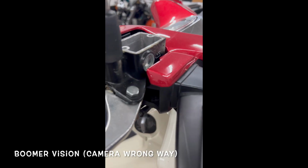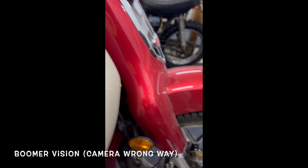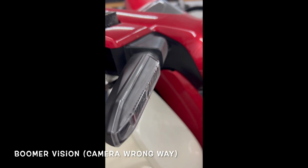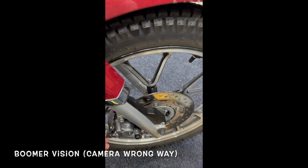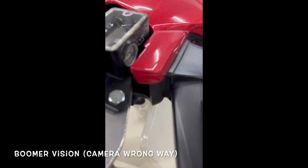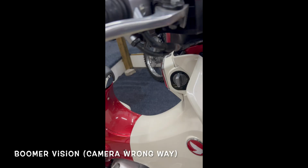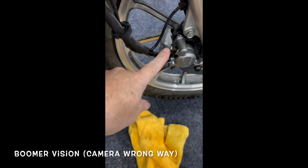And then I'm just gonna start pumping the lever like this. Obviously, I gotta put fluid in here, and I gotta break the bleeder. But I was just telling you this is what the start of it is, and you're trying to just help pump it and run it down so maybe you see some fluid running out of here. All right, so got some fluid in the master cylinder. Left the bleeder open and tapped the line a few times, pumped the lever like this, and I started having some run out of here. So there's some fluid down there.